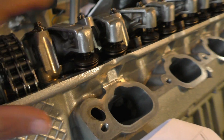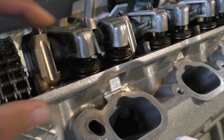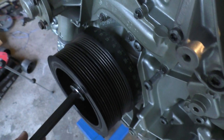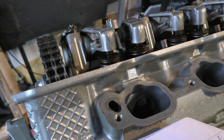You can see that the rockers just moved over here — when the cams are not pushing on the rockers they should have a lot of play, but right now you can see they've reached the point where they're just about to open these valves. I'll turn it just a bit more because I can tell there's still a little play left in them.